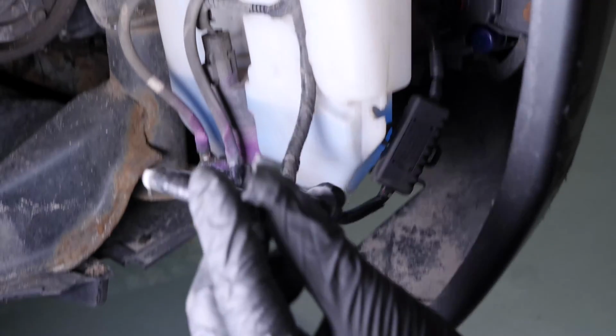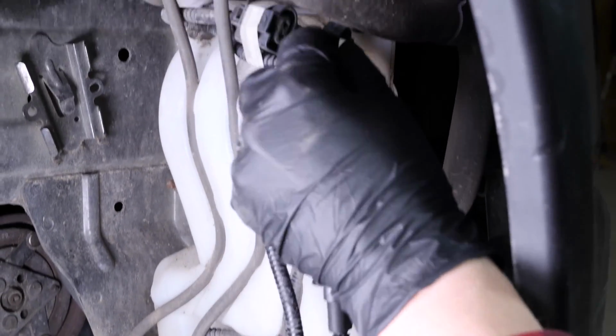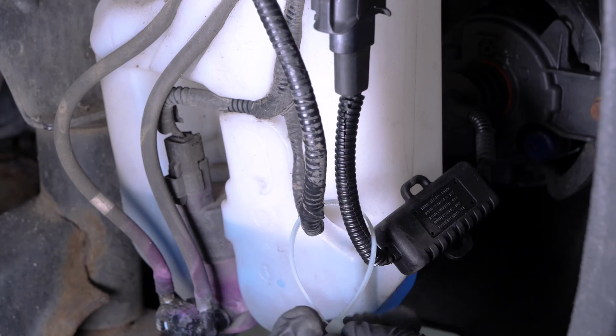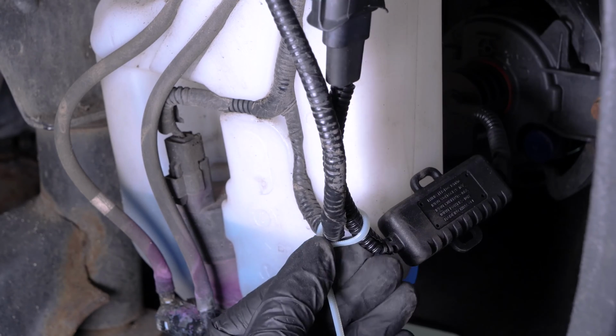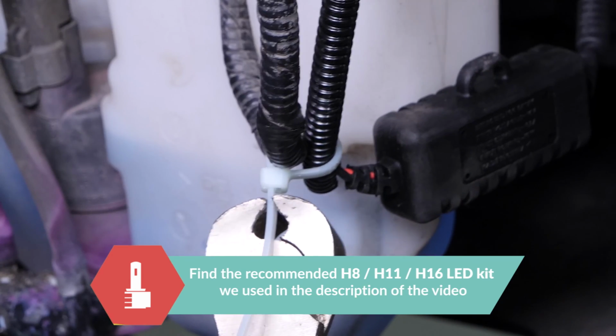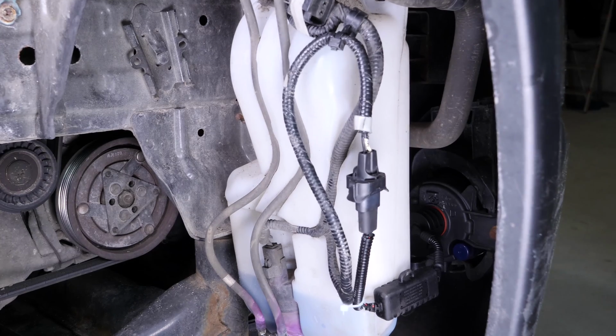We recommend attaching the different cables together to avoid premature wear on the control box and the connectors. For this, you can use the plastic fasteners in the LED case. Once everything is back in place, check that the new LEDs work properly before reattaching the mudguard.